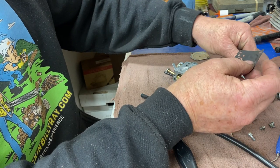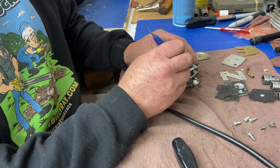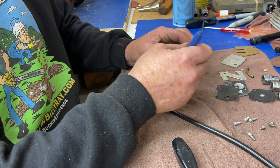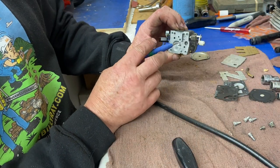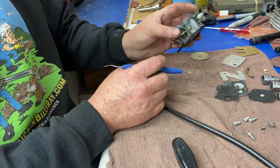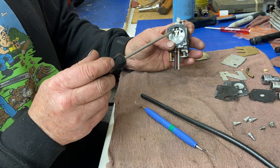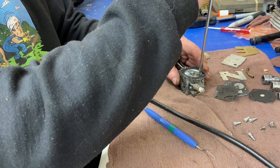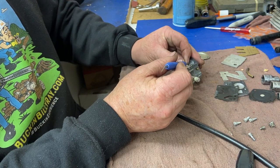There's our fuel pump cover and diaphragm — it's a bit old and wrinkly, but it still looks pliable enough and should work fine. We just have to fix the leak. Blow it all off a bit, make sure there's nothing in there. Screen looks clean but I'm going to take it out using my dental pick — thank you Taylor Walker, my beautiful daughter, who gets these from the dentist for me. She's not stealing them — they're just the dull ones they won't use anymore. Screen's out.